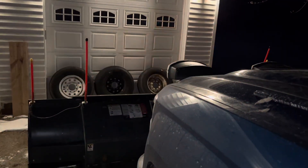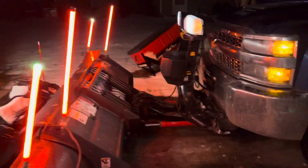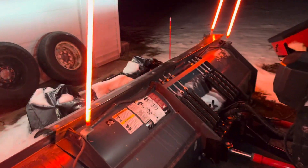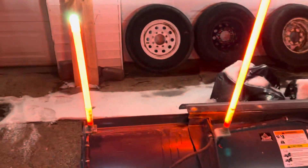If my headlights are off and I turn my turn signals on, the markers will still blink, so in the daytime they will activate and turn on. Overall, really great experience — I haven't had too many issues. I left a large service loop of wire up here because I'm still messing with it. I'm actually getting power and ground off the pump motor here, so there's a 5-amp fuse under the hood, plus a running light kill relay and a left and right turn kill relay — five-pin relays.